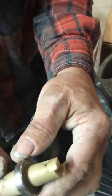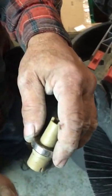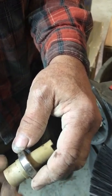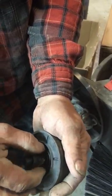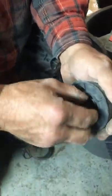To test the bearings, hold them with your finger while you turn. If they're seized they won't turn. If water has gotten inside and rusted the bearings, they're going to feel really rough when you turn them. This one is turning smooth, so this bearing is good. Check the bearing on your brush holder — if it feels rough at all it will have to be replaced.